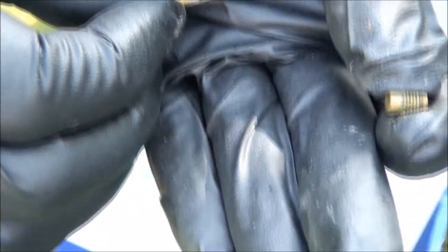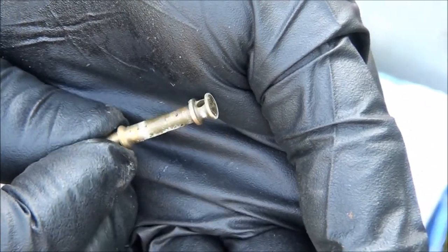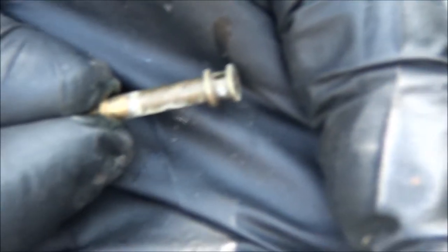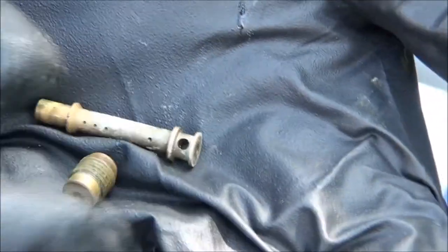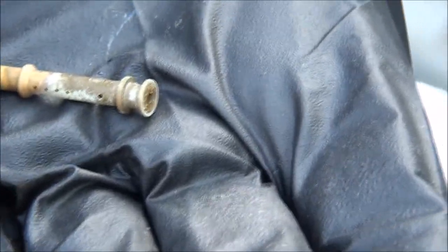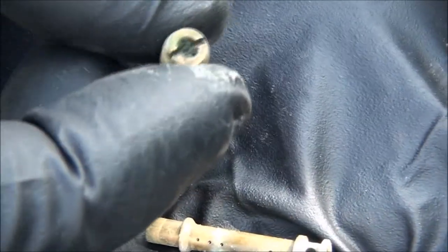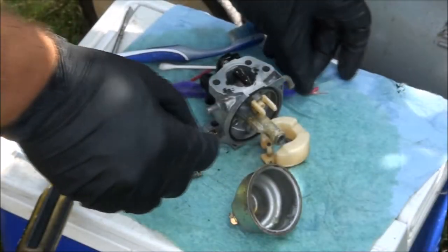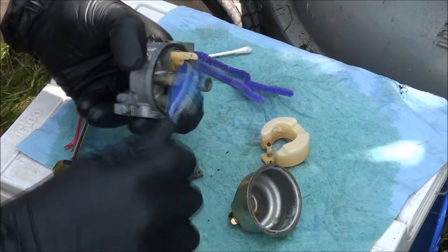You can see the nozzle has a bunch of tiny little holes in it. You need to make sure that all those are cleared out as well as down through the center — it goes all the way through the tube. Definitely make sure those tiny little holes are cleared out. And then on your main jet you just have the one hole that goes up through the middle of it, but you want to make sure it's good and clean. You can tell just by looking that that main jet there is plugged. So let's get this cleaned out. What I usually use is just some copper wire — clean it out, poke it through, and begin brushing off all of this stuff.